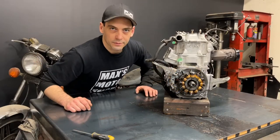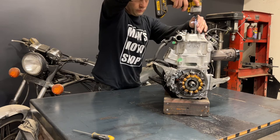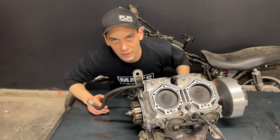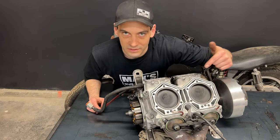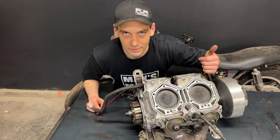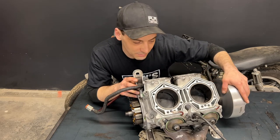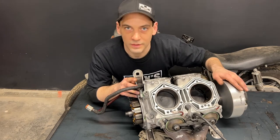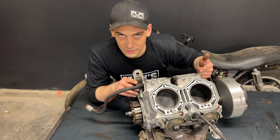Now I'm going to pop the cylinder head off and show you what's going on inside the motor. Now that I got the motor opened up, we can take a look at the pistons, watch how they move, and see just how bad it is. As you can see, both pistons are at the top of the cylinder at the same time. This is a clear sign there's something wrong. The pistons should be moving opposite each other — one should be going down while the other is going up; one should be at the top while the other is at the bottom. As I rotate the motor, you can see both pistons are moving down at the same time and then they both start moving up at the same time as well. This is why my motor was only running on one cylinder. The mag side was still in time. The PTO side was way out of time, down at the bottom of the cylinder when it was trying to fire.